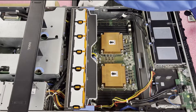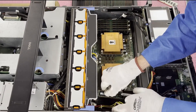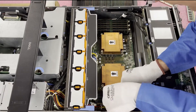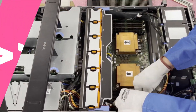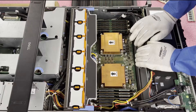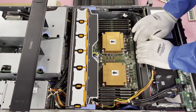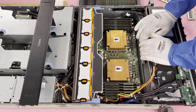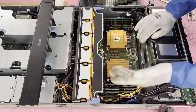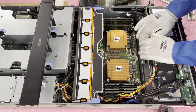I'm going to fast forward and start loading the rest of these up. One thing to note: the key is going to flip on this side, so just be careful to make sure you are not seating it the wrong way. Just like that, we can load 192 gigabytes — in real time that took two or three minutes. It's very easy to do. We also hear a lot of questions about comparisons between the R5500 and the Dell Precision T5500, so here's a link for the T5500 you can check out for more specs.